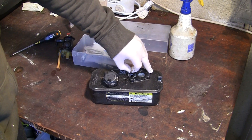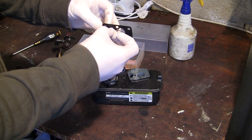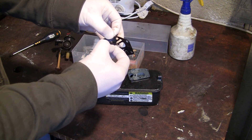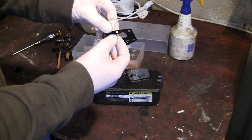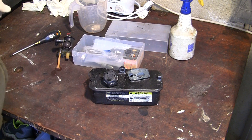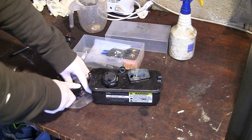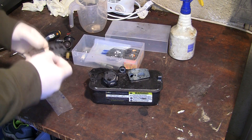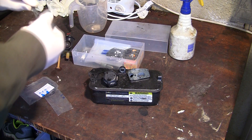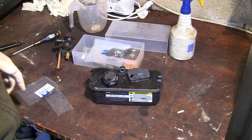There's already a diaphragm and gasket on here. When you split this, the thinner part is the diaphragm. What people are apparently doing when they've serviced the carb and it's still not running right is simply adding an extra diaphragm. This could actually be a useful tip for anyone who's serviced the carb, cleaned everything up, put it back together, and still can't get the lawnmower to run. If it runs alright with two diaphragms on, it might get you out of trouble.